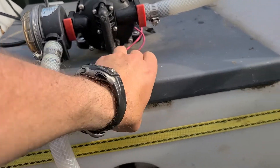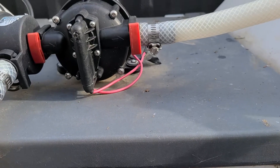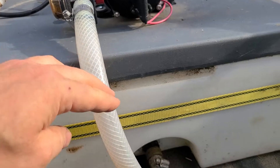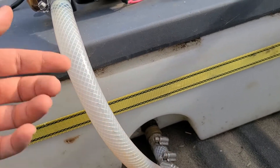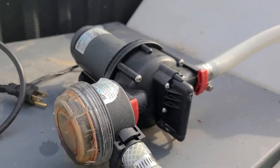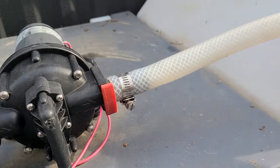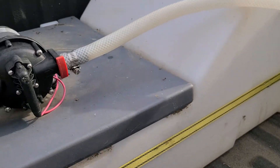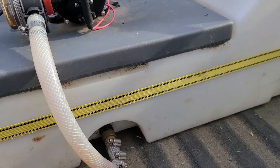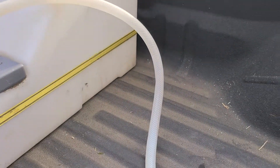This top piece here is actually a storage compartment designed to hold your hose and everything else, but mine doesn't open up as much because I've got this pump screwed down on top. The hose goes to give you the water intake — there's a filter on the side of the pump, it's kind of rusty but it doesn't really matter much for horse water. These are quick connects to take this all apart, and then an outlet hose going off the other side. A roll of hose at Home Depot was a 10 foot section, so after cutting the pieces I end up with a little over eight feet on the discharge side.